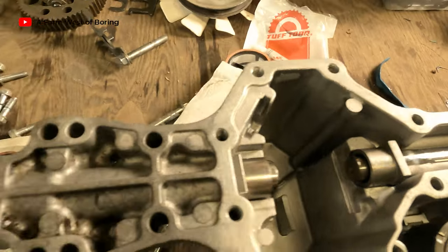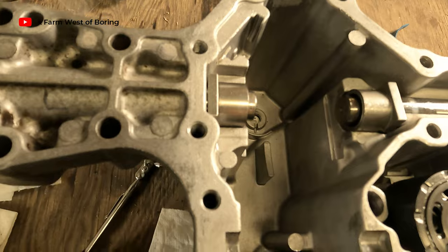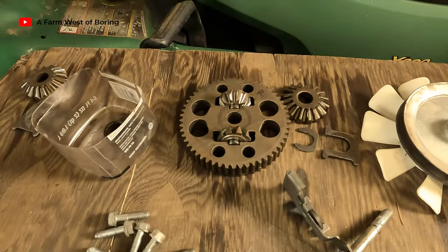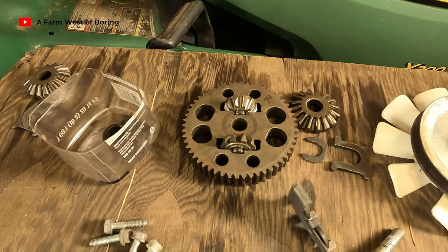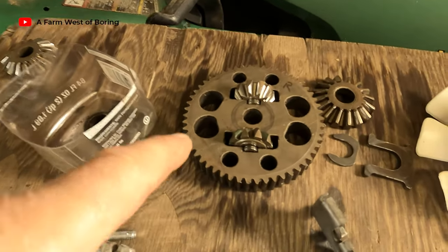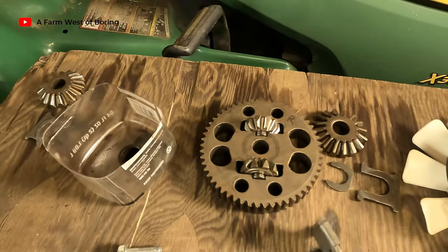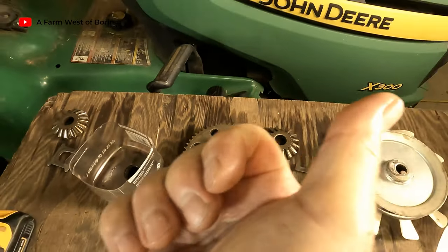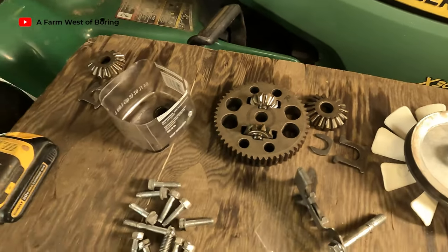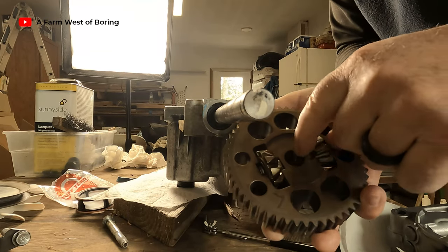I've got both the short axle and the longer axle. I'm going to pick up the differential gears and put those in place. I have a mark from when we took it out - I put R on for right. So the right goes that way and the left side goes that way, and you can see that the indented part here is on the left.